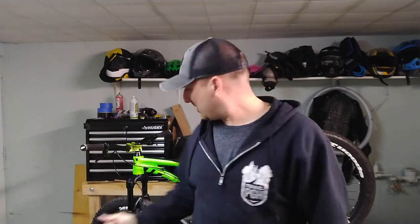If you have a bike using a cable-operated brake — be it a hybrid caliper like this, a fully mechanical disc caliper, linear, cantilever, or rim brakes — do yourself a favor and upgrade from standard housing to compressionless. Origin 8 offers some nice kits that include everything you'll need: the housing, the cable, cable ends, and some frame protection pieces. You won't regret it and I promise you there will be an increase in performance. Alright, let's finish getting the bike together and go for some test rides.